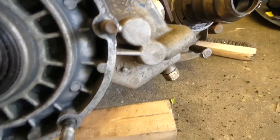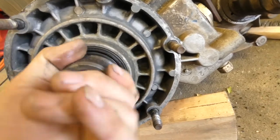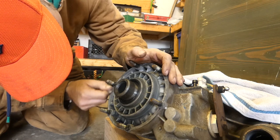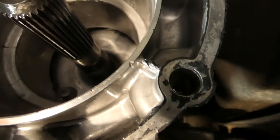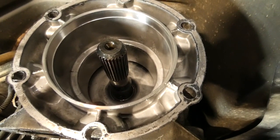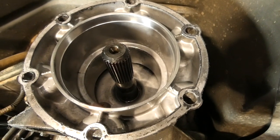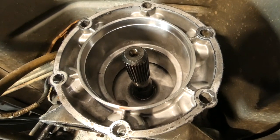You can see I've gotten a lot of the gasket material off. Biggest thing is you want to get it off around these where it tends to stick. If you've got a piece that sticks out, the fluid is just going to drain out of there. Get all this cleaned up real good and throw this bad boy back in. Hopefully it goes as easy as it came out. This side is pretty good. You can see we've got a little buildup around all the bolt holes, so we want to clean that up. Let's clean this up and get some goop, go to town. Transfer cases are so hard because they're such an odd shape that there's no real good way to put it on the jack because one end hangs lower. It's almost just easier to lift it in by hand - just bench press it up in there.